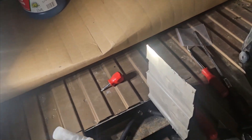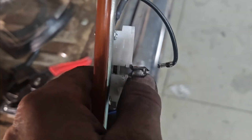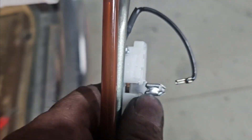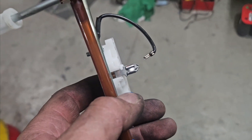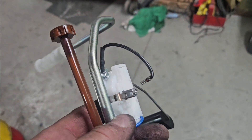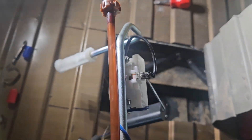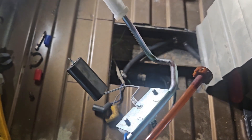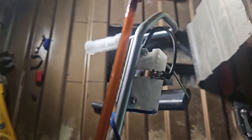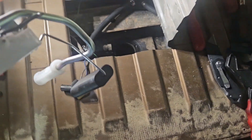I put the new unit in, turned the key, and the fuel sending unit wasn't doing anything. I took it all apart and found the wire inside is broken - it's actually soldered but now it's been soaked in fuel. I cleaned it off, soldered the wire back together, ohmed out the sending unit, and now have proper ohms - before I had zero ohms because it wasn't working. And I didn't catch myself on fire soldering a sending unit soaked in fuel. Let's try it again.